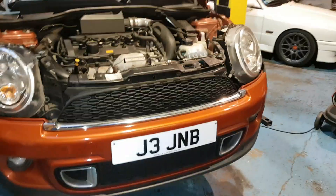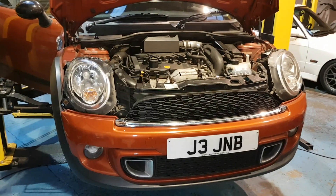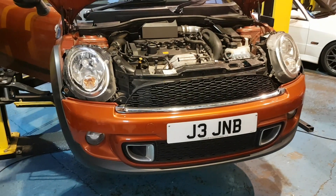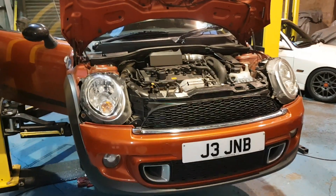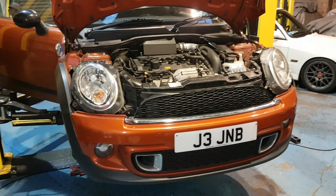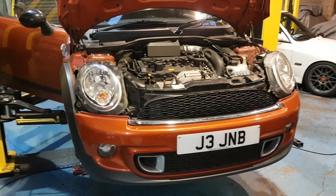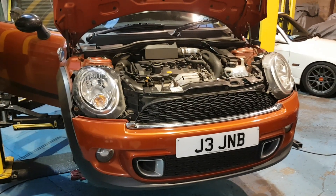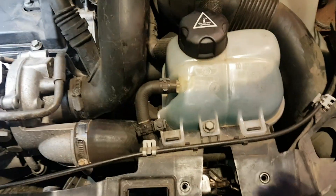What happened on mine is the tensioner had gone and they were knocking against each other making a pronounced noise. So if you've done a brand new water pump on this Mini or any work on this Mini and you've noticed the water pump isn't turning — that's the main reason I'm making this video. The friction wheel not being engaged is actually meant to be like that. It is ECU controlled, and the friction wheel won't engage until the car reaches its operating temperature.